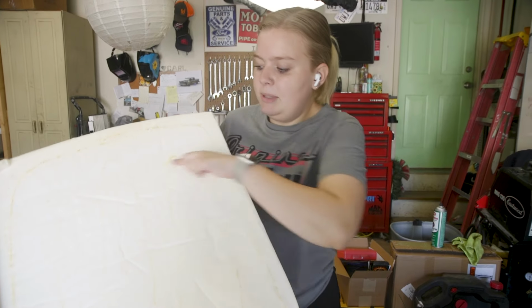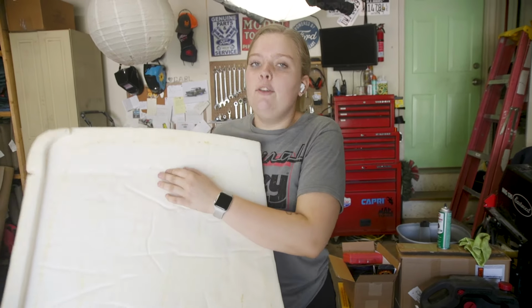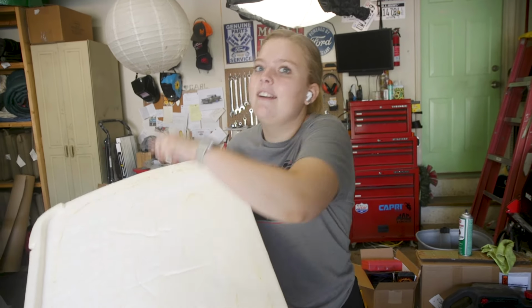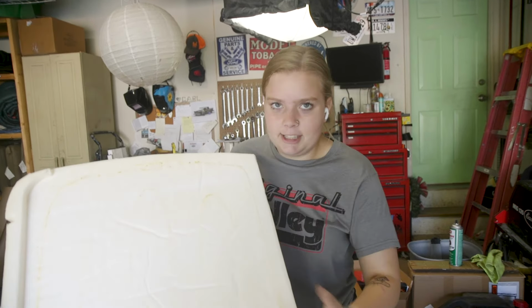So that's going to stick down here, but it has to have something to grip to on this side, which is why you put another piece of listing wire on this side and hog ring that, so then you can put the cover listing wire onto the foam listing wire and then hook the foam listing wire onto the chair. So listing wire basically hooks everything together.